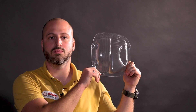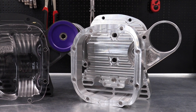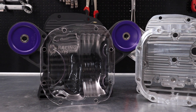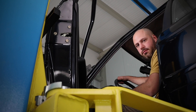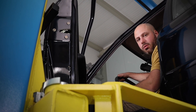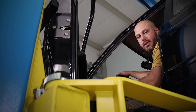We need the transparent rear cover so you can see the oil flow. We're going to compare our profile to the flat design profile, which is most commonly used by other billet cover manufacturers. This flat design is much cheaper to make as you can produce it from two pieces. But again, we are not driven by profit — we aim for the best performance. We mounted the transparent cover to the differential and I'm going to accelerate the car so you can watch the oil flow. It is important to spread the oil evenly to the front bearings and back, so make sure you check the oil level when I accelerate.